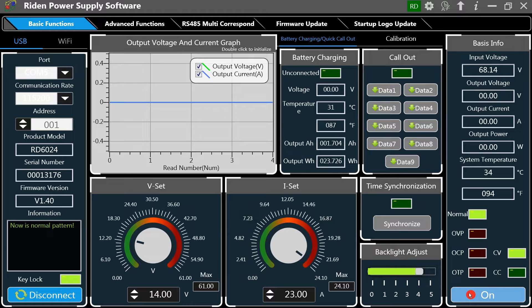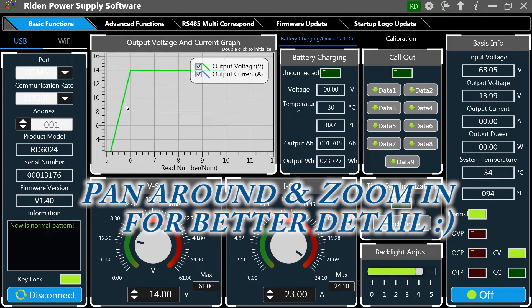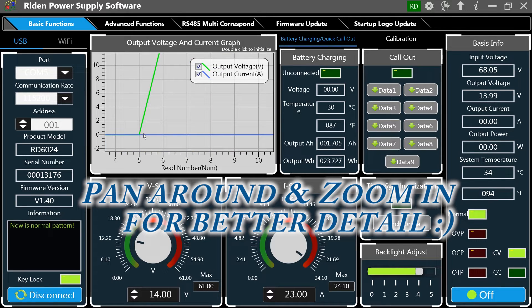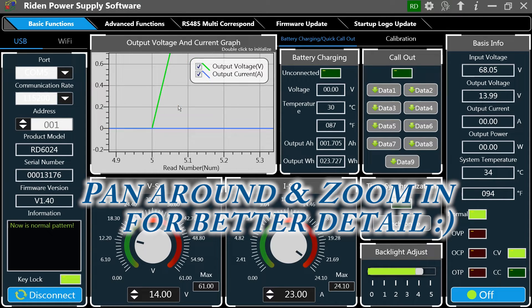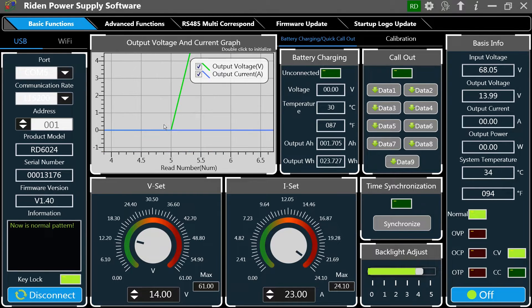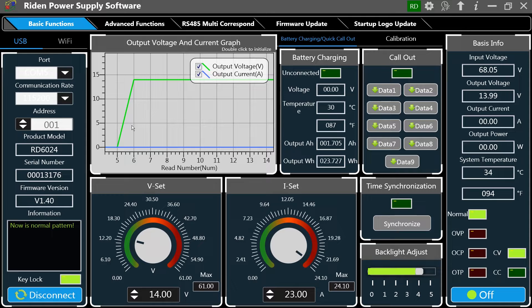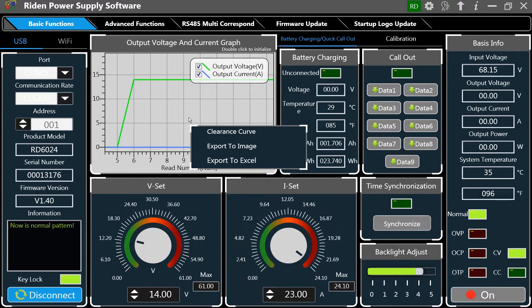Let's clear this out and start over. Let's turn it on and see what happens. The voltage went up to 14, the amps did nothing — it didn't even get a chance to do anything; it blew the fuse right away as soon as I turned it on. So if you have a vacuum cleaner you think is garbage, it's probably because it blew your fuse. Do not put a bigger fuse in your car just so it'll run — definitely do not do that.